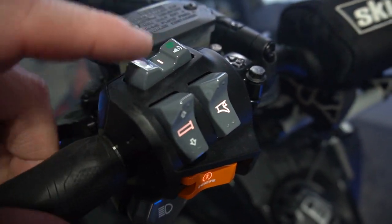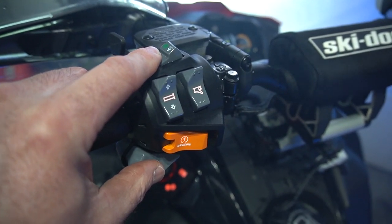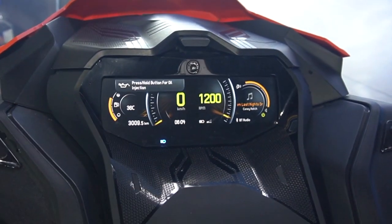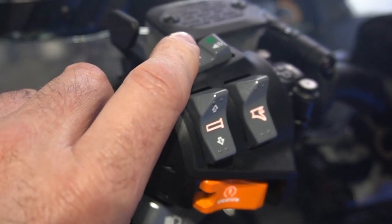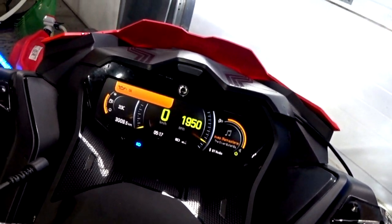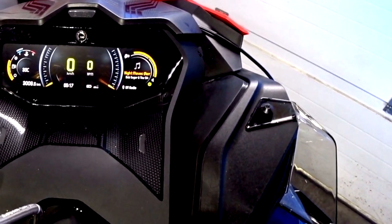This is your mode and set button from previous models. You want to hold down on the volume down button and rapidly press and release high and low beam until you see the screen change. Now it says press and hold button for oil injection. Set goes into oil mode. It will rev up, it will shut off, and then this bad boy is ready for summer.